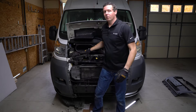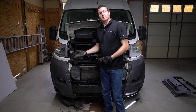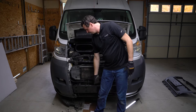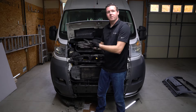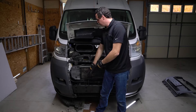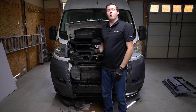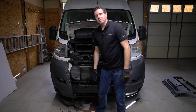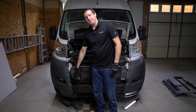We had to jump ahead a little bit and removed this front grille and fascia a little bit early because this is a 10-year-old ProMaster, and at some point someone must have run up on a curb or one of those parking cement blocks, and it bent the bottom part — the support bar that holds up the bottom of the bumper. That bracket from Luverne has a little notch where that support bar is supposed to slide in, but ours was way too high because it had been bent up, so we couldn't get that bracket in place. We had to take this part of the grille and fascia off so we could bend that back down and get our bracket to fit. One thing I did notice with all of this removed is it's actually a lot easier — you can pull these off to the side and with an extension you can get a ratchet in there and tighten and loosen those bolts really easily. So you may want to remove this earlier if you're having trouble reaching those bolts.